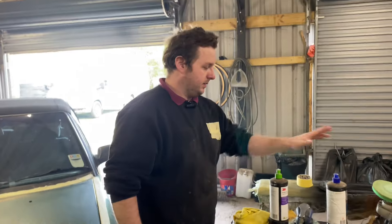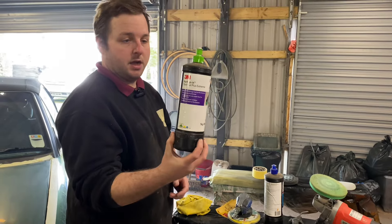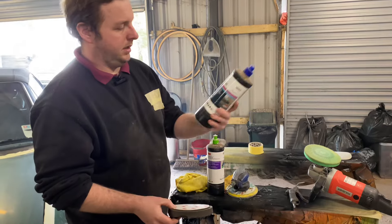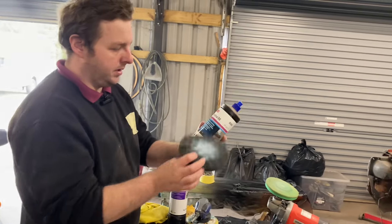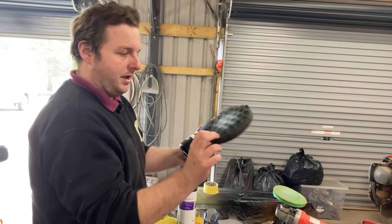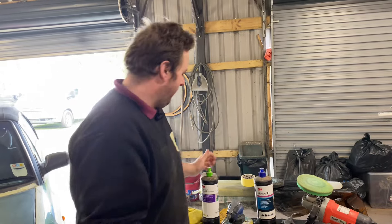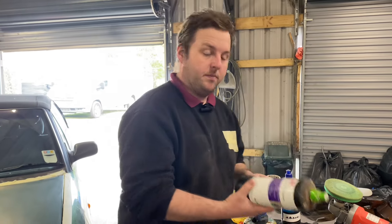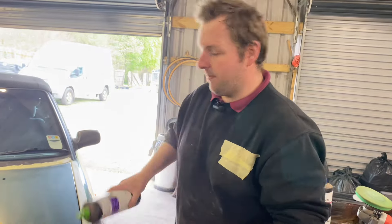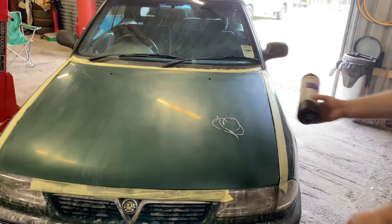What we're going to use now is polish it back up to a nice high gloss finish. First one we use is 3M Fast Cut. Secondly, with a different mop head, we use the 3M non-trade blue top — it's ultra fine — and with a nice soft mop head. For most trade users, they're pretty much the best you can get and it really does bring it up fairly well and fairly fast. So we'll start polishing and see how it comes up. Hopefully it comes up really, really glossy.